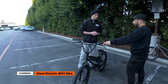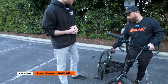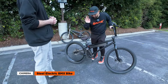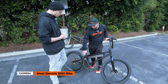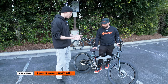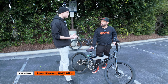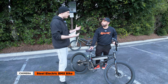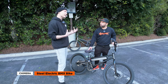When I saw this bike, the thing I was really interested in was the drivetrain. Can you elaborate more on what inspired this design? There were really only two major motor options on the market: hub drives and mid drives. Hub drives seemed like a non-starter to us — they were too heavy and all that weight was in the back, so that's rotating weight. It made for a sluggish feel and those drives aren't very electrically efficient.